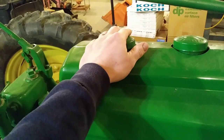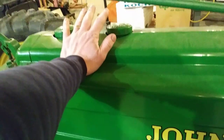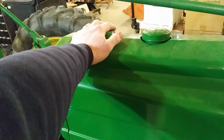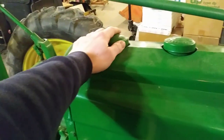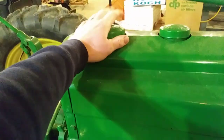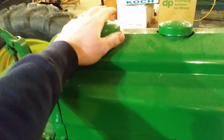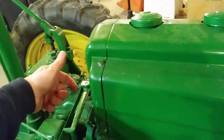At some time somebody's going to put something in that small tank and it's going to flush into your fuel system if you're not careful. So with all that in mind, I'm going to cap off the bottom of this tank. This is the primary tank — the only tank that's been used for years. Somebody has actually put what looks like old motor oil in the bottom of this tank, I'm guessing to keep it from rusting out, but it's in nasty condition and unusable. I don't want to use it or have anybody accidentally use it, flip that valve, and let that crap go into the carburetor.